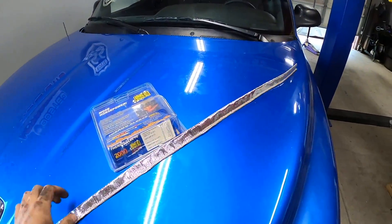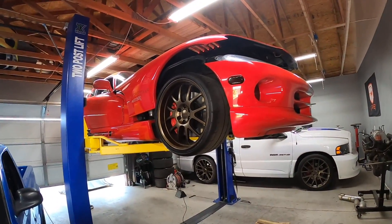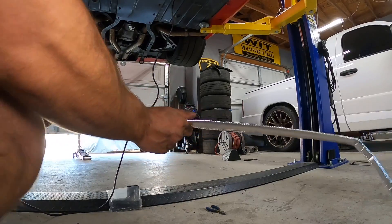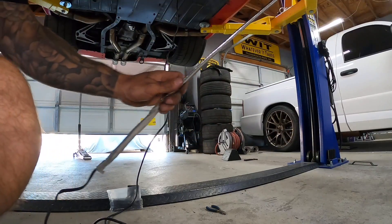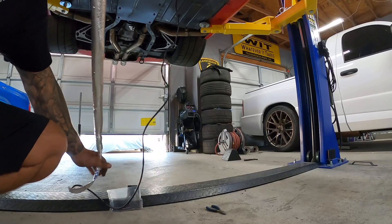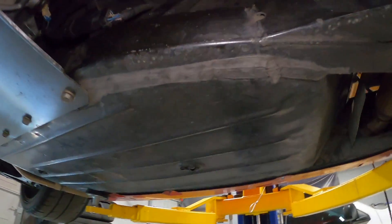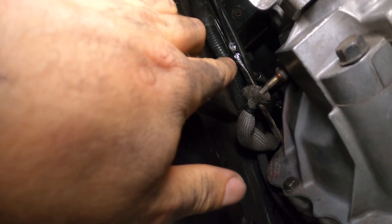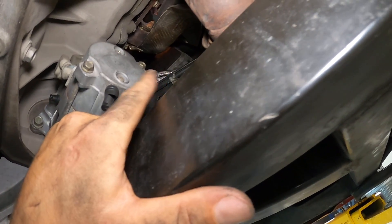Because it's probably the only thing we're gonna have to run in that area through all this heat, we want to make sure we're not gonna have issues in the future. Probably the easier way is to get yourself a coat hanger or one of these fishing rod type deals and just pass it through — otherwise it might take you a lot longer. There we go, wire's through! I put a little zip tie on the end of the heat wrap so it doesn't slide, and a couple tie wraps around the actual wire harness so it follows the factory clutch line.